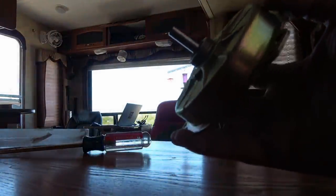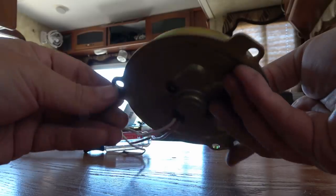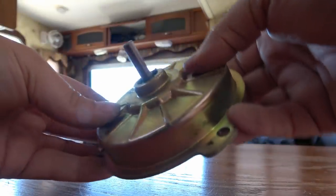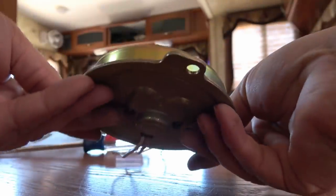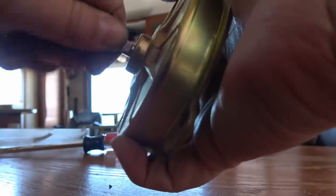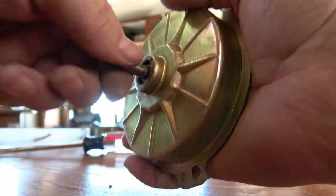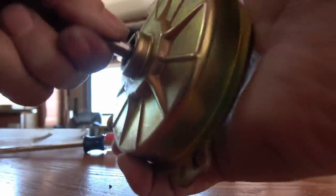There's a little screw at the bottom of the fan I had to take off, and the plastic was quite tight on the spindle there so I had to use a screwdriver just in between there — being really careful not to break the plastic — but I got it to release. The top has three screws that I've taken off so I should be able to get this all apart now. I got the motor all out, but unfortunately this motor looks like it's not serviceable at all. They've sort of stamped the lid on, no way to get inside to access anything. I don't see any lubrication ports. Definitely that's the squeaking — hear that squeak.